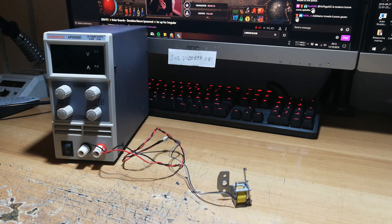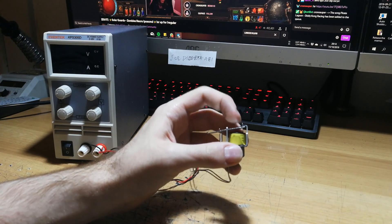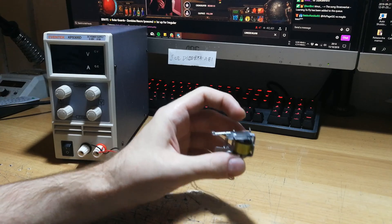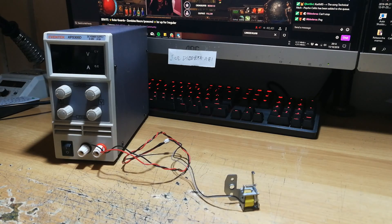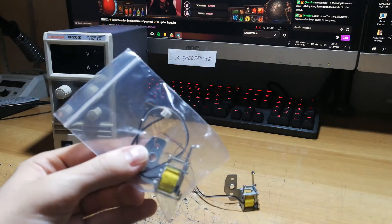But some of the newer printers like the C410W, CLP 360, 365, etc., apply current for only a short amount of time. The pulse is so brief that if you don't have the pad, the solenoid will not actually close and the printer will not load the paper correctly.